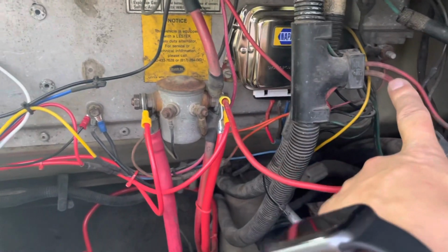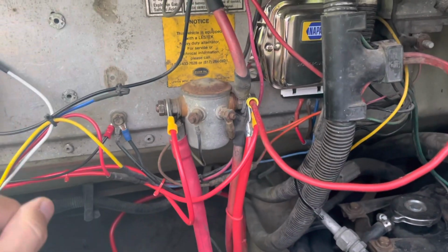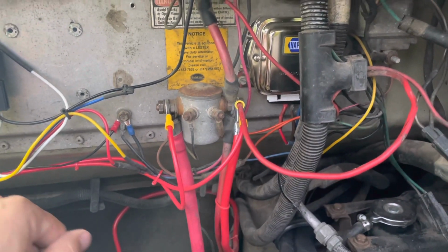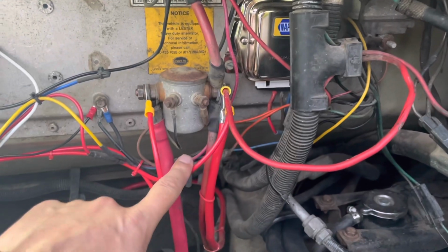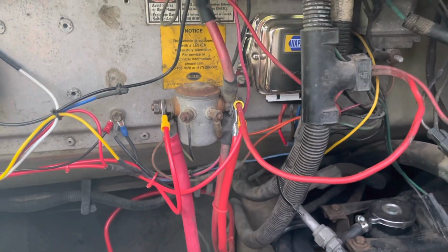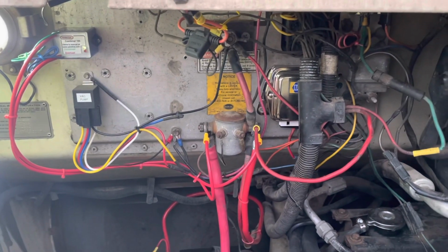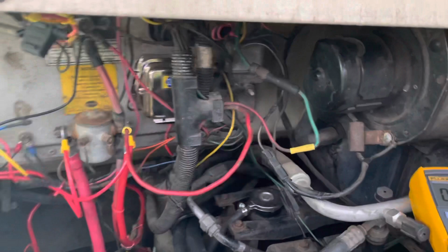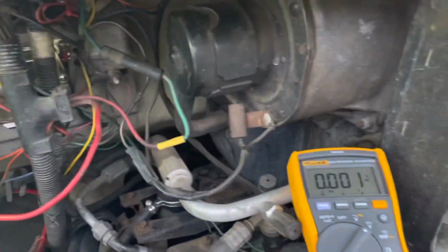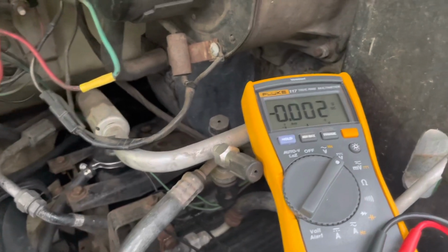And then the alternator wire that was running over to the isolator, now I'm running just to the side of the boost solenoid that is connected directly to the engine battery. So I think all of that is going to work out fine. Now I've plugged it in, and I am just letting it charge based on the house battery.